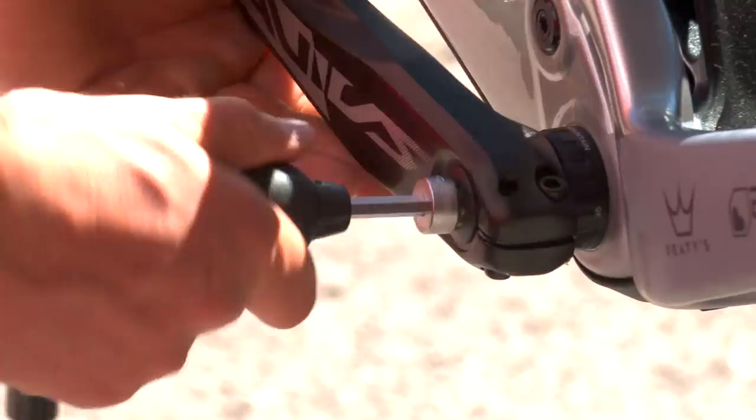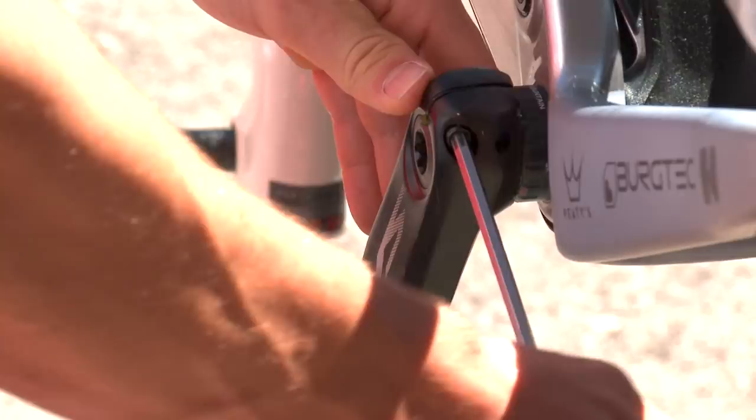So this is really important, to put the right torque on it. You don't want a lot of torque, so you go in and feel it's good, and then untighten a bit, put it back in, and back again, and you're good. Both screws at the same time, little by little. Yeah, good. So you want those two quite tight. It says something on it. It says a torque, 12 to 14. Okay, perfect. So yeah, 12 to 14.